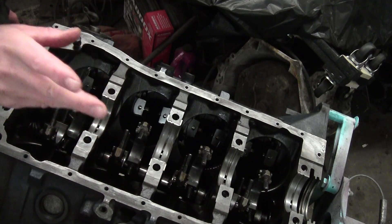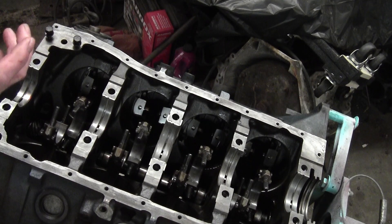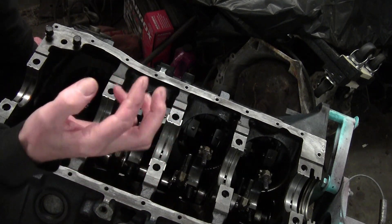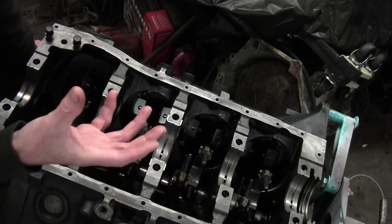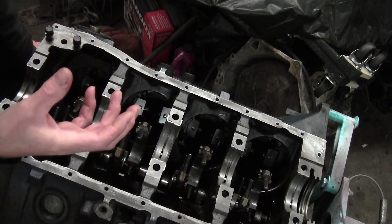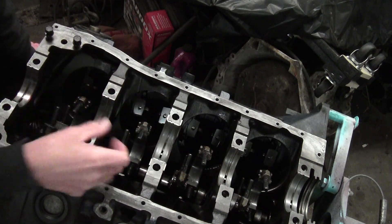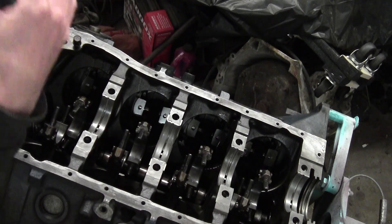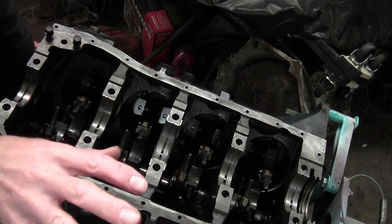Some of the things I wanted to show you here on these Fords — if you're like me, you kind of geek out on this kind of stuff. Back when Ford first introduced their overhead valves in the Y-blocks, they made the switch from the old flatheads to what everybody else was going to. They had huge oiling problems, and they tried a few things that just didn't work. That led to a lot of warranty work, so they decided to correct that with the FE. But with the first generations of FEs, they starved the bottoms and over-oiled the top, so those first FEs had oiling problems. Later on they slowly started to work them out. This is a '77 and it's pretty much the same as all up through on the big block Ford.